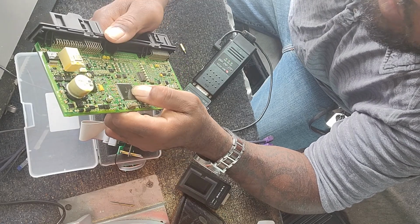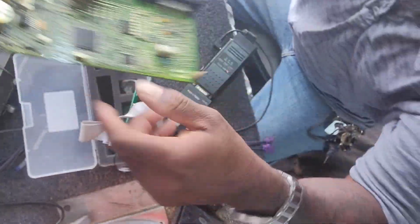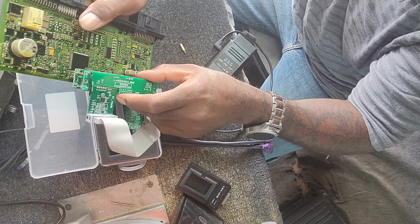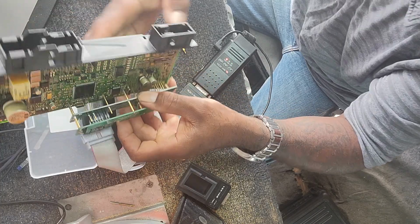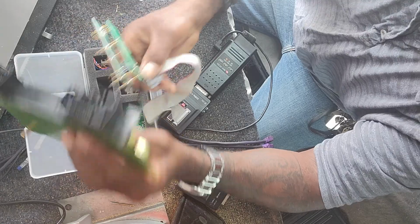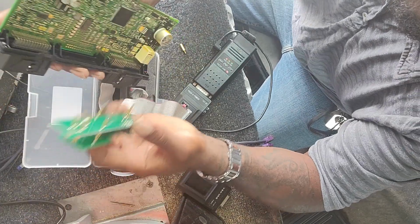On this car, it is a 5M48H. I don't know if you can see it. You see it? That middle number, that's the mask number. You need to know that number. You need to have that number when you open up the software to actually do the read, or else it's going to fail or ask you for information that you don't need. So please pay attention to that. Very important. So I'm going to put this back together. Let's take this adapter off and put this back on.